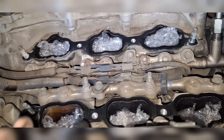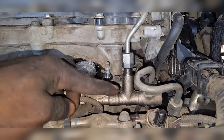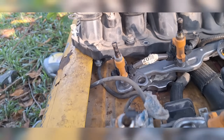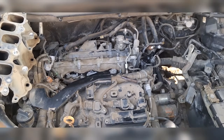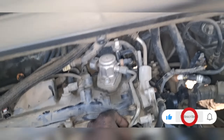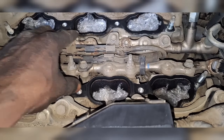This is the second set of nozzles I've taken out. This car has two fuel pumps: the in-tank low pressure fuel pump, and the external high pressure fuel pump that works with the high pressure injector lines. These are the low pressure injector lines that I took out — they are very, very dirty as you can see. The other six nozzles are the direct injection ones, located right inside the engine going directly into the combustion chamber.